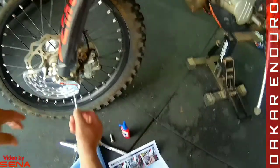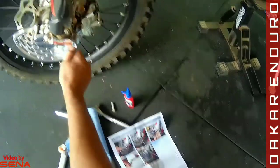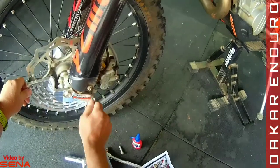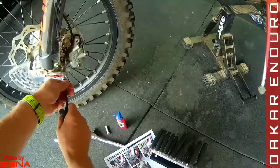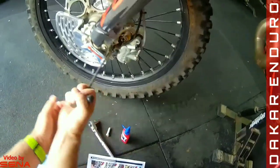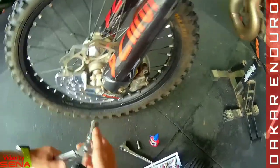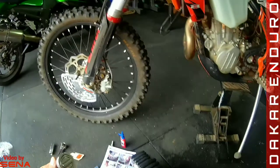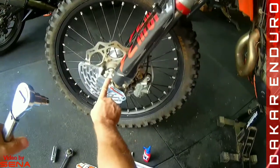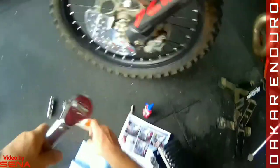This is medium strength loctite, and for this bolt it's going to be an Allen wrench — looks like it's a 5.5 millimeter. Using Google we've come up with 33 foot-pounds for the 17mm axle bolt and 18 foot-pounds for the other fastener.